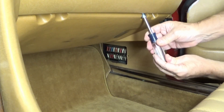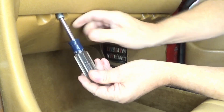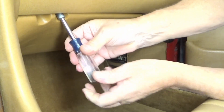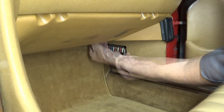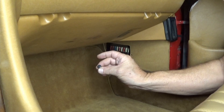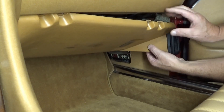Next I'll remove these 10 millimeters — there's one here and then there's one on this other side. You might even have a Phillips head screw on the other side; I don't believe mine does. 10 millimeter with a large washer. And then right back here, one on each side, there's a little clip — but you might have a screw. I have one of those on each side. So now this thing can come down — comes right down, no problem.